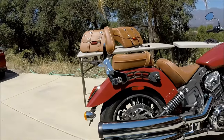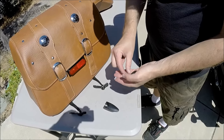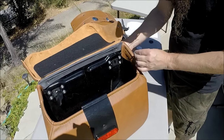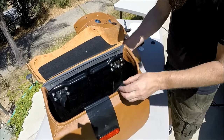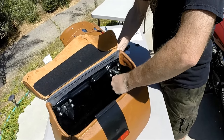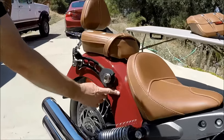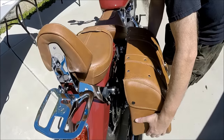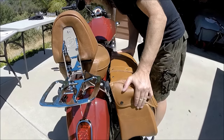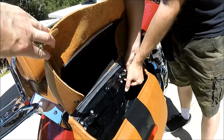Lastly, it's time to install the bags. Six separate pieces make up the parts that hold the bag to the bike and must be assembled. When the latch cam is pressed down for the first time, it will lock the dowel pin in place. There's a clear sticker attached to the fender to prevent the bag from rubbing. The anchor shafts slide into the spools and when pressing the bags down, they hook and lock in place on the spools. Once the bags are properly positioned, simply press down on the latch cam and the bags lock in place.